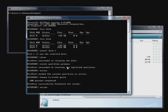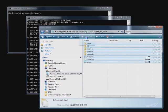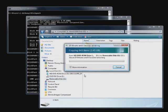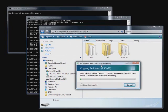I'm going to assign a drive letter to it, so I can go over to Explorer and see it as the G drive. I also have the installation bits on the DVD, so I'll drag everything onto the thumb drive. Once the copy is complete, we will have a thumb drive with the Windows 7 installation bits on it, ready to boot off — for things like netbooks or any machines without a DVD drive. It really loads a lot faster than an optical drive.